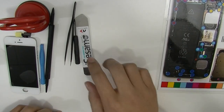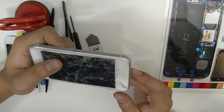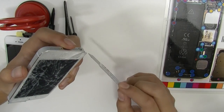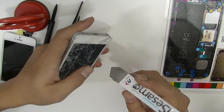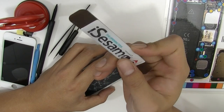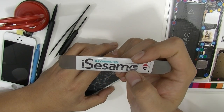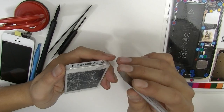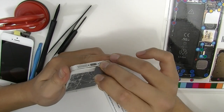Alright, let's continue. For the iPhone 5, they designed it almost like the 3GS where you remove the screen from the front, instead of like the iPhone 4 and 4S where you have to take off the back and take off everything. So first, I also have this pry tool — I find it very useful, from iSesamo. You can also find this on Amazon or on our website at CyberDocLSC.com. So at first, you kind of want to get the pry tool in between the rubber and the aluminum case and pry it open.